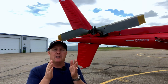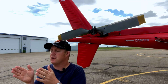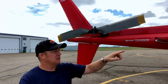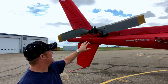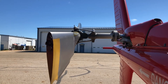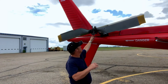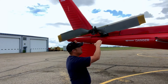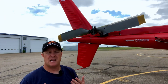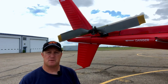So when I want to turn the helicopter — if I want to turn to the right, for instance — I'm going to push on the right pedal, and through a mechanical and hydraulic linkage it comes down to this linkage here, which moves this slider up and down, which then moves these pitch links, which then adjusts the pitch of the tail rotor. By adjusting the pitch of the tail rotor that creates more thrust or reduces the thrust being produced.